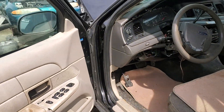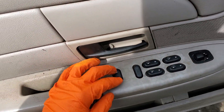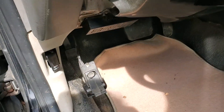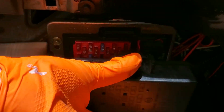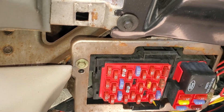What's going on guys, I've got a 2006 Crown Vic here and I'm going to use this car to point out the location of the multiple fuses and the relay for the power locks and the power doors. Starting inside the vehicle, we're going to open this up. You pinch it on either side and pull down on the cover. This is going to show us two different fuses for the operation of the door locks.